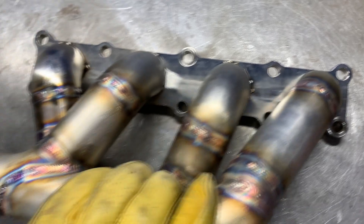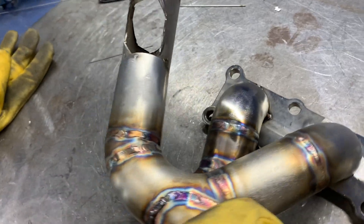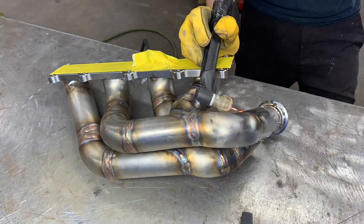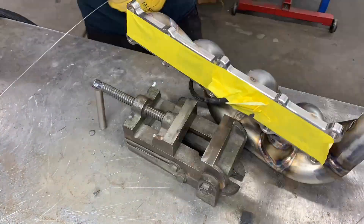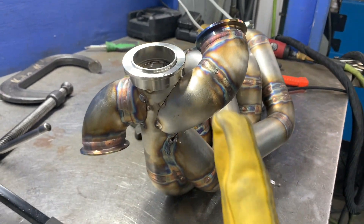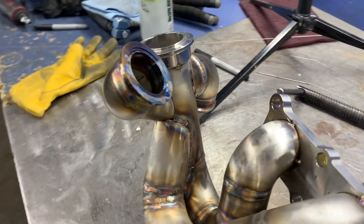Install this, get it fitting just right, tack it onto the flange, and then go ahead and burn this into what will become the collector. Then it's just adding the wastegates and fresh air anti-lag. The last step of this manifold is the same as the rest — clean and fit the wastegate tube and the fresh air anti-lag to the manifold, cover everything up to back purge it, and weld it.